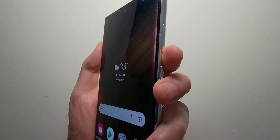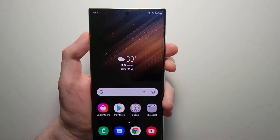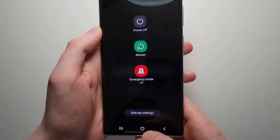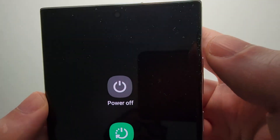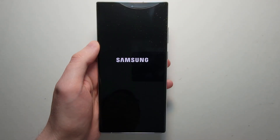The main way you turn it off is actually by holding down on both the volume down and the side key for a few seconds. Here's the power menu — you can also get there by swiping down twice. So just going to power off, and then I'll show you guys how to remap it.